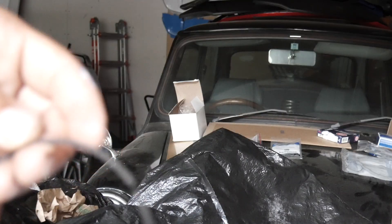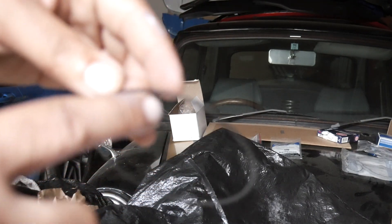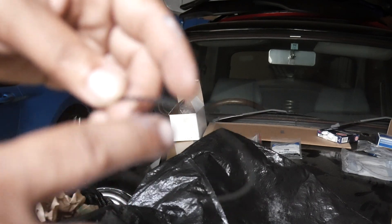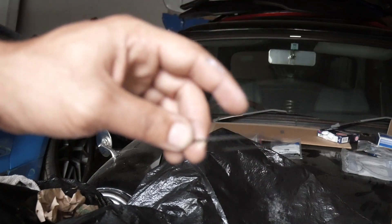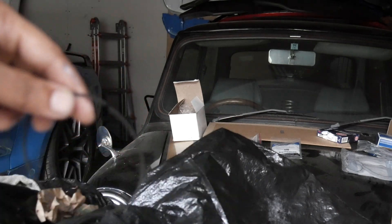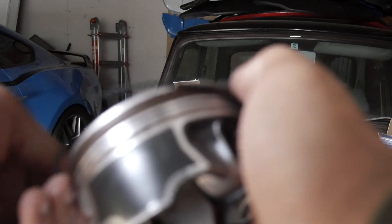This one's going to be hard to see. When you're looking at this ring it's pretty easy to put it on — we're not going to need any of the pliers to get this on. There are little tiny ridges at the back of this one on top of what you see here; that is where your oil ring needs to rest in front of. If it's on top of it you have a little bit of a problem with these things not moving around the way that they need to. So we're going to go ahead first and put this one here in.